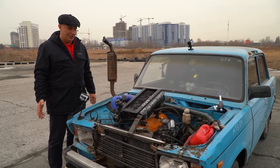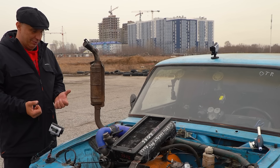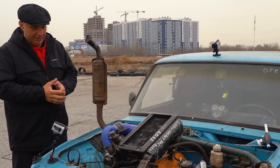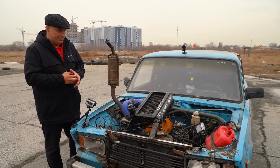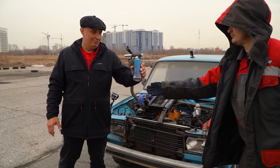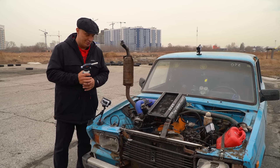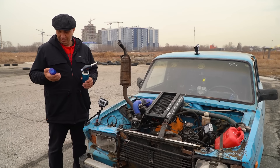Now it's all a matter of starting the engine and putting it through its paces — we'll see how it performs, how it behaves and so on. The thing about this diesel is that we are not running glow plugs on this, which is not ideal, because there's not going to be any additional heating for the air. We decided not to set anything like that up, and instead we're using a simple solution, because this starts very well on hot air. On top of that, we're also using some quick-start fluid to make things that extra bit easier.